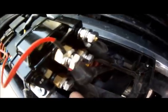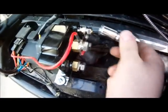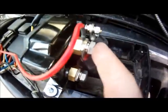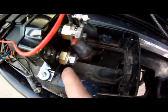Again, we're not going to bear down on it just yet for what its final mounting is going to be. You can see here, we've got all of our hot legs now mounted up. Down at that bottom left, blue, red, followed by yellow, and then white. So these I've already completed. But with regards to how much torque you want to put on them, this is a 3/8 inch socket, and it's only as much pressure as one hand can put on. Just make sure that that lock washer down there crushes, and that means you've put enough torque on it. There's no reason to over torque this application. They're just holding on hot legs. These are not going anywhere, especially with the nice lock washers that Winch provided.